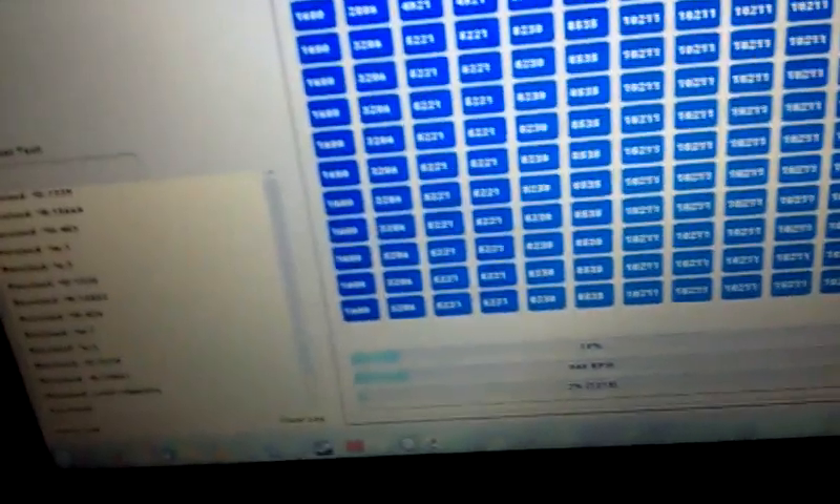The last thing is I have the fuel map recorded in the EEPROM now and I can update it whenever I want through this program I've written. I can just load it up, display all the values here and hit this button, which is cool.